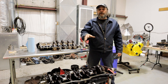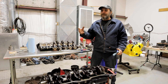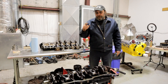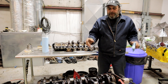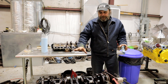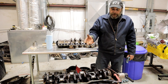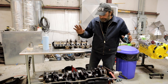Now we've gotten to the hardcore parts of our teardown. Hardcore because up to this point everything is pretty much straight disassembly and easy observation — a broken piston. But at this point, before you pull the crank out of the block, you want to check the way things sit, the way things lay, because this tells you whether the crank is going to need work, whether the block is going to need work, what you're going to have to replace, what's usable, what's not.